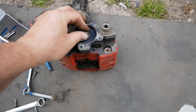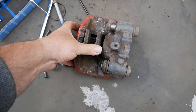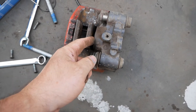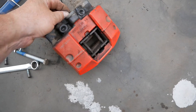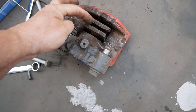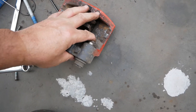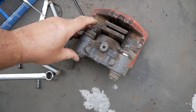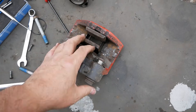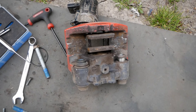I've already managed to lever this pad a little bit and proven that the piston is nice and free. You can actually turn this by hand and the piston is moving in and out quite nicely, so there's nothing wrong with the piston. The sliders are all okay too, but I'll take those apart and lubricate them as well.